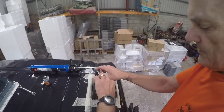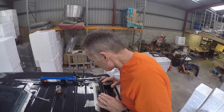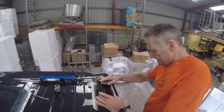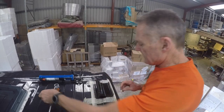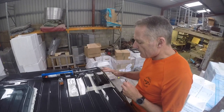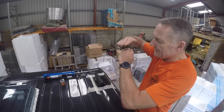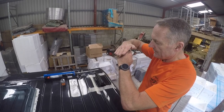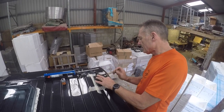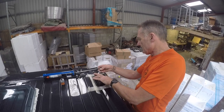Just put the nuts on up to where the nylock is and now I'm just going to position it exactly in alignment with the masking tape. I do want to tighten this down but at this stage I'm not going to over-tighten it — I just want to nip it up, allow the mastic to go off, and then once it's cured I'm going to come along and tighten it down more effectively, squeezing the already-set Sikaflex against itself to provide a little bit more cushioning. Because if I was to squeeze it all out whilst it's wet then it loses its effectiveness.